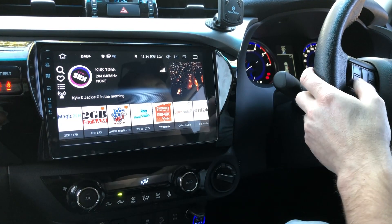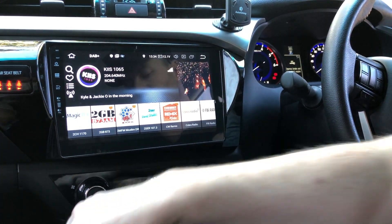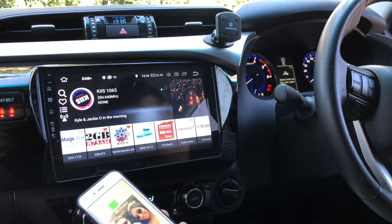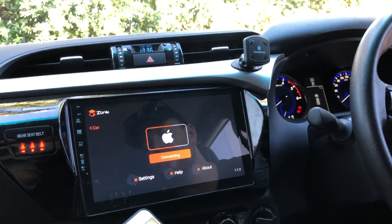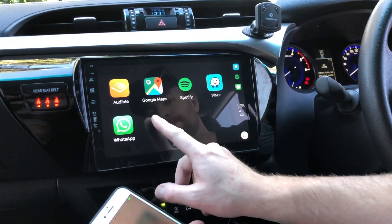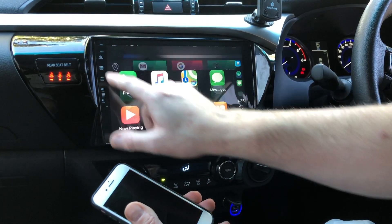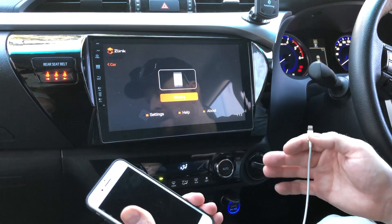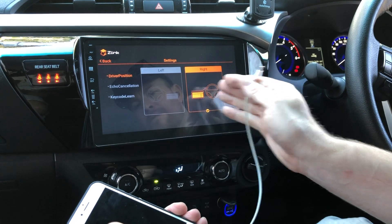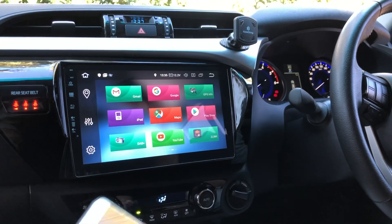We also have Apple CarPlay working off the factory USB. If you are doing Apple CarPlay or Android Auto, please ensure you use a genuine Samsung or Apple cable because it makes a difference — they generally work slower or don't work with a long or non-genuine cable. Apple CarPlay works through a system called Z-Link, which is an external app that makes this work because you can't typically put CarPlay on Android units. You can change settings to have the taskbar left or right depending on your preference.